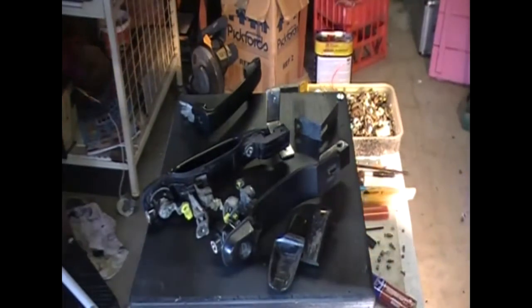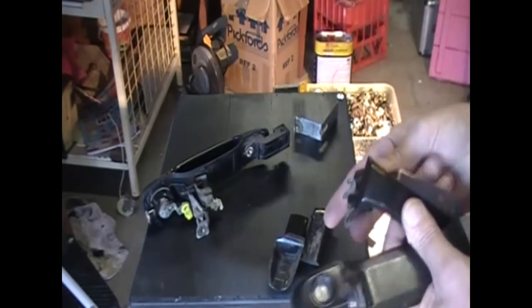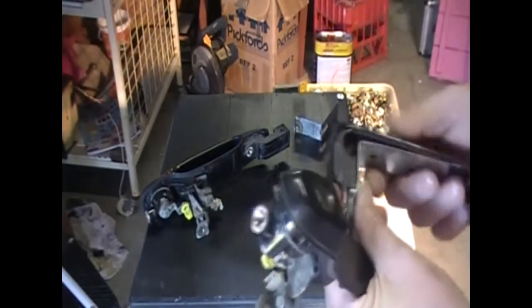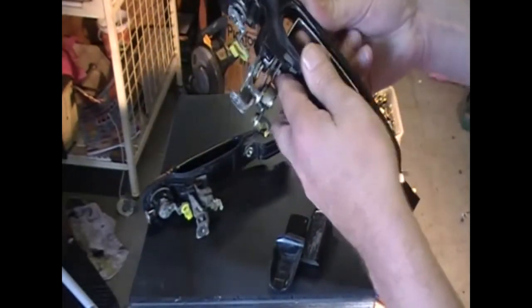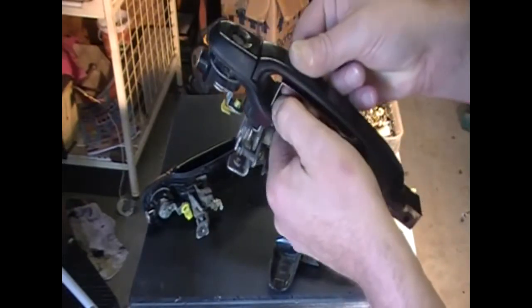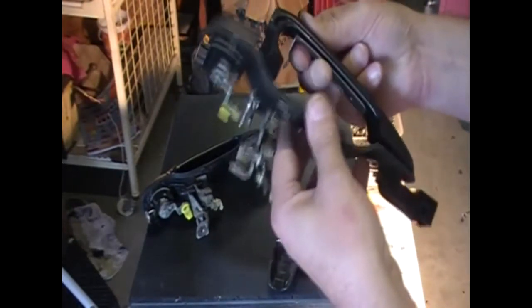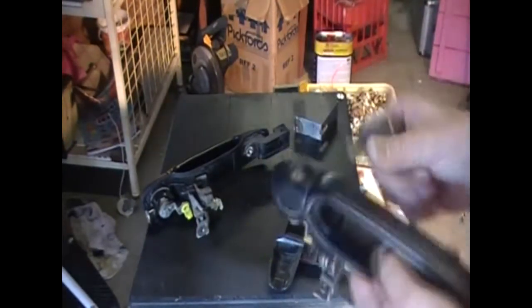So that's that out of the way. So now I'll just show you the driver's door handle back in with this mount. You can see I could probably go to 1.5mm thick material. This is 1.2mm steel. So it goes in like so, and there you go. It's not going to stop it. You know, there's play in between the mount and in there still. So this is going to work out perfectly fine.